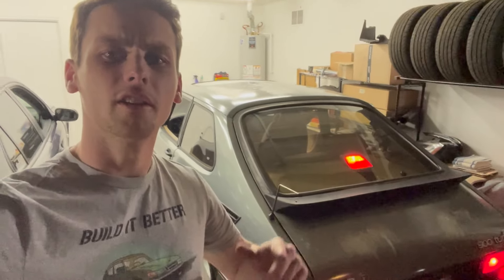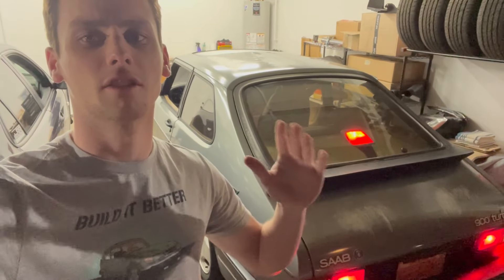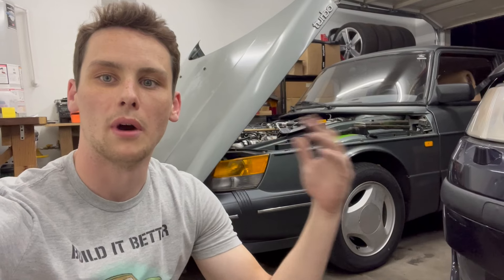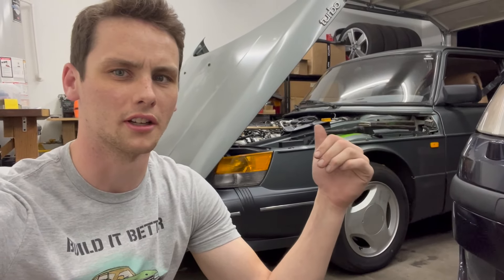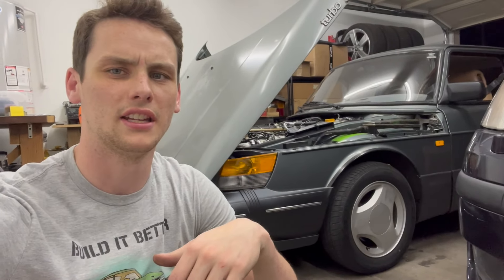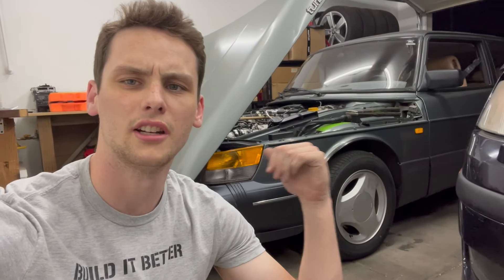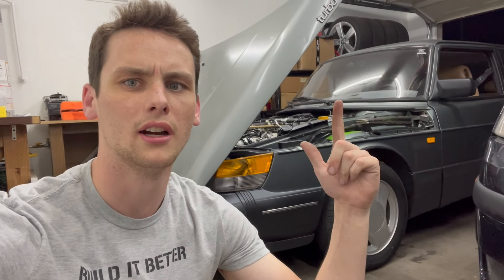I'm going to reinstall this in the car. Hopefully you can see what I'm doing here. First thing I'll do is just plug the switch in, then press it in and make sure it's actually working and the brake lights come on when it gets depressed. I came back here to film — you can see the brake lights are on. When I press the switch down, the light should turn off. Just reviewed the footage and, as you can see, that worked. So now I'm going to slide it back into the bracket, screw that nut on, and make sure everything lines up properly before testing it with the pedal.